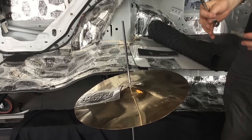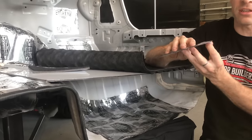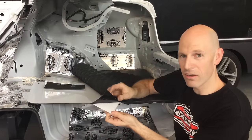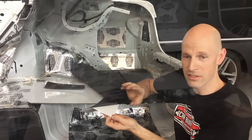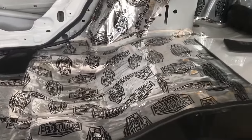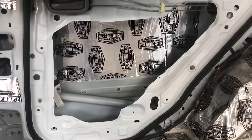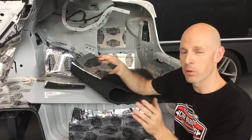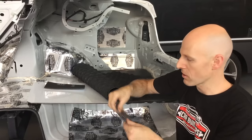What the dampening sheet is doing is absorbing that energy so the vibration can't resonate. What the material consists of is a rubber lower layer which is self-adhesive. It doesn't actually have an adhesive glue on it — the actual base material itself is sticky. This means for vertical and inverted applications the product will stick, and you're not at risk of an adhesive layer breaking down over time and the product failing. This is why a lot of automotive manufacturers use this throughout the car, including on roof skins.